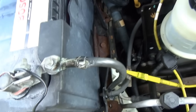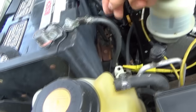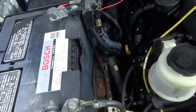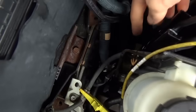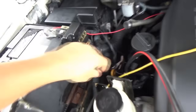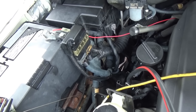So we do need a new ground cable for this Nissan. How do we fix this? No parts required — we could shorten it and cut it, but this cable is really toast. So let's do a little proof of concept bypass check: just put a big jumper cable from here to the engine and get it started. Here's the proof of concept — we're jumping with the black lead from engine to the terminal and we can still measure the voltage drop; it should be close to zero. Before I start this engine, I want to make sure it has engine oil in it — it looks like it has plenty of oil, so I'm not too worried about that. Let's fire it up.